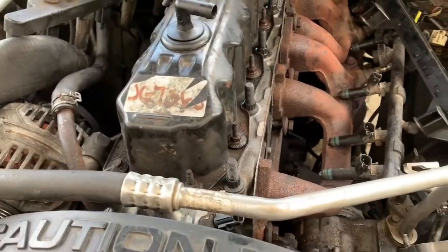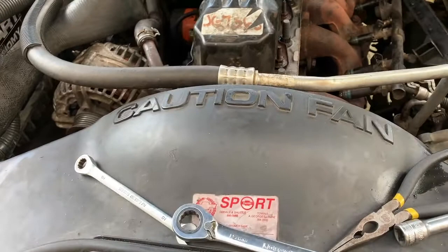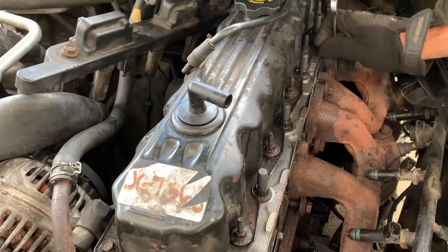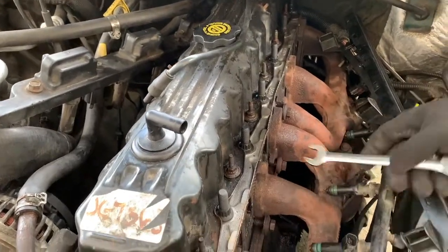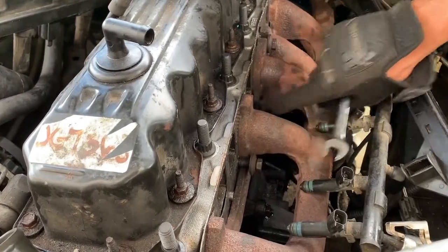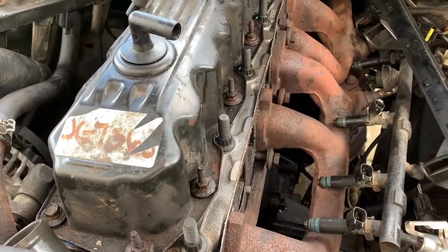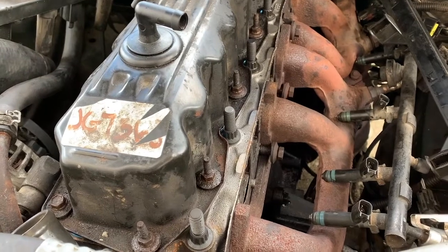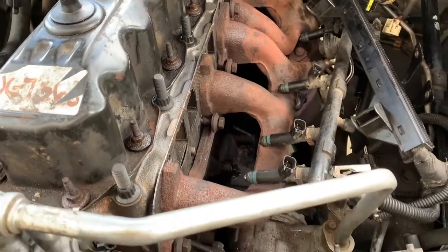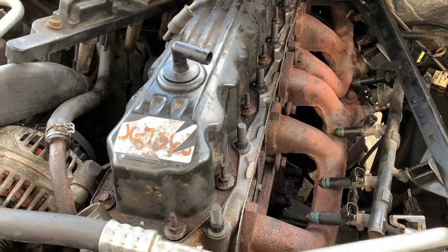So now he's putting the exhaust and intake back on, getting ready for the intake manifold. After the intake manifold, which is kind of tedious, right? You got to put all these bolts in on the bottom, but you can't tighten them because the intake manifold slides behind this little nut here, and then you have to tighten them both down at the same time. So there's a little bit of an art to it. And you can't see them either. Once you get that intake on there, you can't see them. You got to work your way down there with your hand and just feel for the bolts. Yep, you got to kind of know where they are and just reach down there blind. You can't get to them from underneath. You can't get to them above. It's coming in the side.